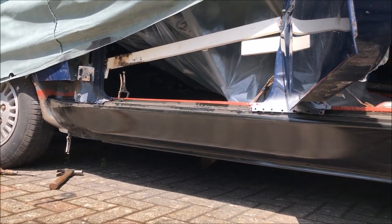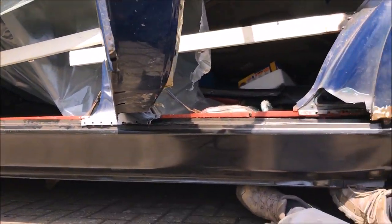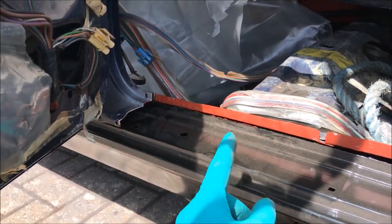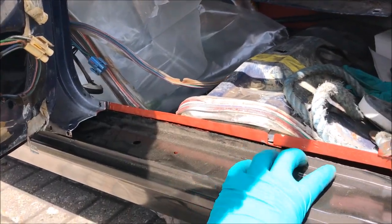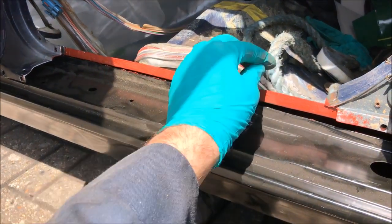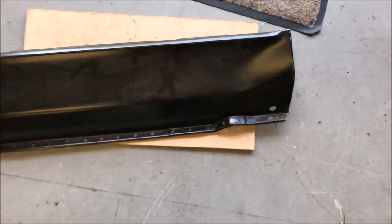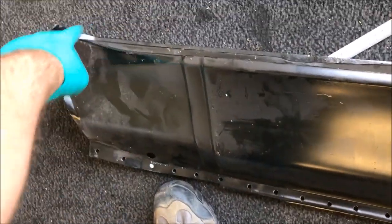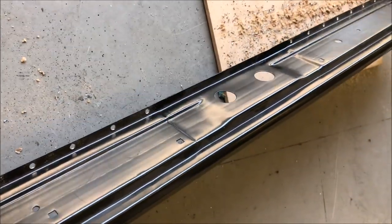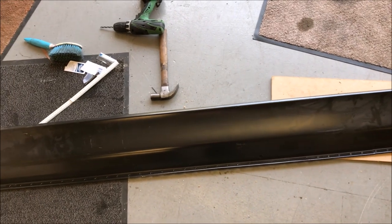As I lie here, you can kind of see what's going on. I'm just trying to wedge that up and in there to get some idea of how easy this is going to be to get in. At the moment it's being a bit of a problem because I need to hold all of these seams open while I slot this thing through. I really need to be pushing up from underneath with a screwdriver just to lift that flange up and then I can clamp it. That took a long time — all of the holes for plug welds are drilled along the bottom flange. I've done all the way along the top as well to the rear end. I haven't bothered doing the middle bit or the end bit because the holes are already there in the inner sill and B and C pillars.